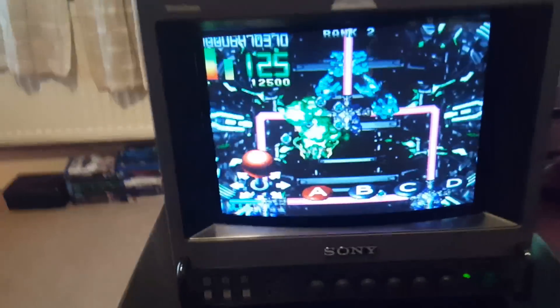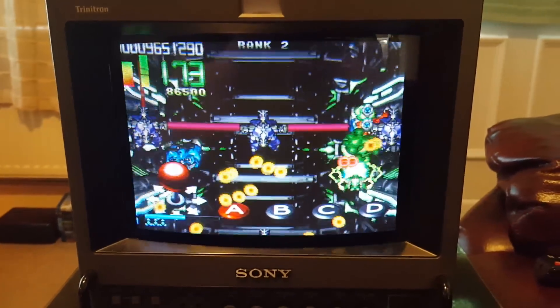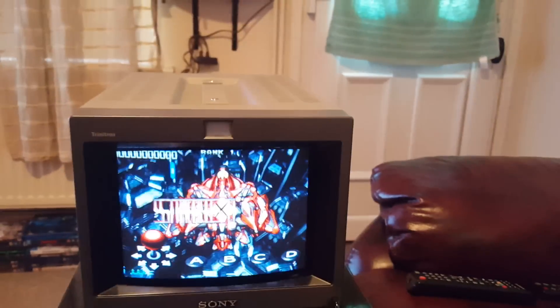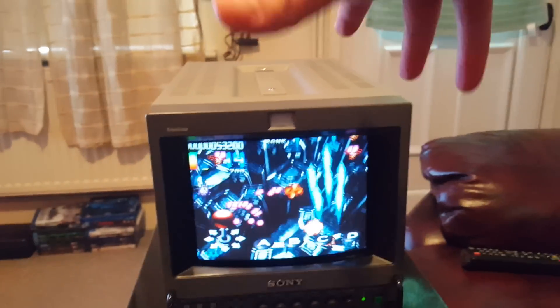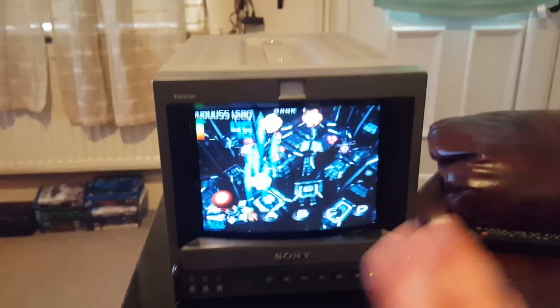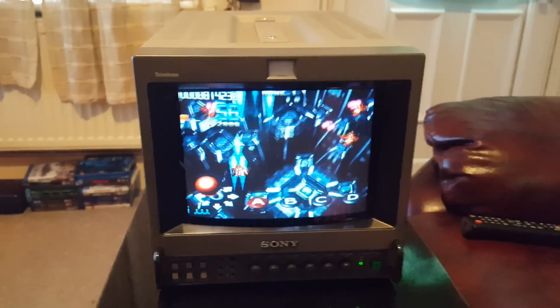Then turn it off. You don't want to be doing it for too long anyway because degaussing coils do get warm if you use them for more than a few seconds. Then look at the monitor — it's just fine and dandy, no funky colors. Even if you don't intend to mess around with magnets, it's still a good thing to have, because CRTs are touchy — even moving them while on can cause the Earth's natural magnetism to make them go a bit funny over time. So a good degas every now and then is definitely a beneficial thing to do.